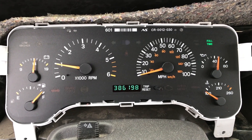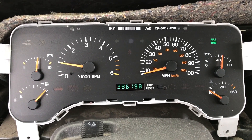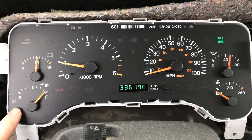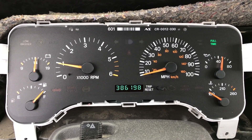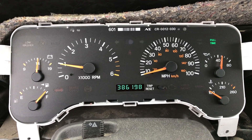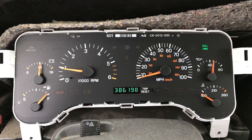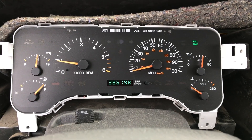This has now been reprogrammed as an exact duplicate of the broken cluster — copied over, cloned, ready to go. No odometer fraud. This procedure is also useful if you have a Cherokee with idiot lights and want to upgrade to a full gauge cluster without committing odometer fraud or having incorrect mileage. You don't need to remove the clear plastic cover — I only did that to reduce glare for the video. Just pop off the rear plastic cover once the cluster is out of the vehicle. Please don't commit odometer fraud with this — just use it to maintain and keep your vehicle on the road. Thanks for watching.